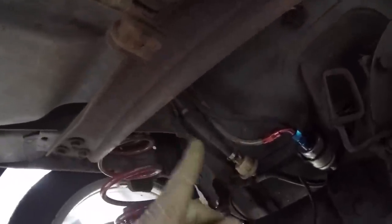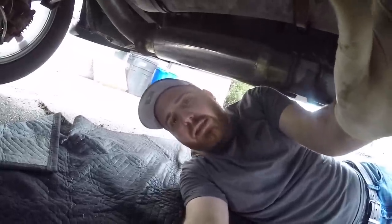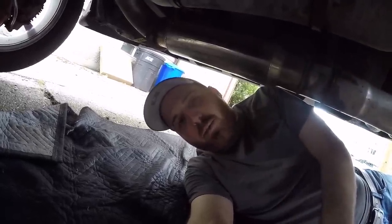When I'm actually changing the pump, this is all getting ripped out. I'm still running hard lines because I don't want to run braided line all the way to the front — that'll probably come in the next video when I put the blower on. Right now I'm changing the pump in the tank. Rather than dropping the tank again, I remembered I have to pull this whole pipe off just to get the tank out. So I figured it's time to cut a fuel access door inside the car. Done right, it looks great, it's extremely functional, and gives easy access to fittings and the pump.